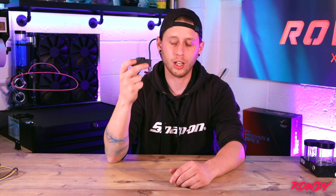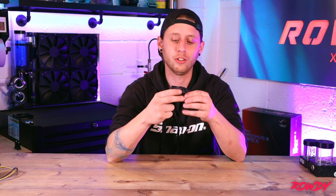In all honesty, as a little tip — if you're in an ITX build and you're using just one rad, it doesn't matter which one of these you're buying, it's going to do the job. So don't get lost in the world of specifications. If you're a proper numbers cruncher and you want the absolute best efficiency, then obviously you're going to need to work out what kind of resistance you're going to have in the loop versus what pump you would most optimally and efficiently use to run that loop. But generally speaking, you don't need to worry about it too much, and that does go for the D5 as well.